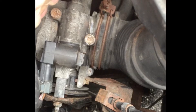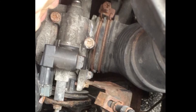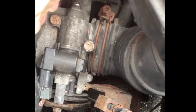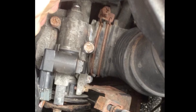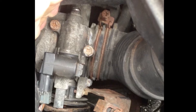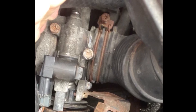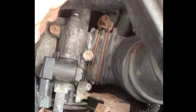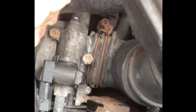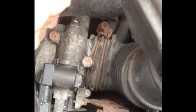Put it back in and see if the problem goes away — most of the time it will. However, if it's still doing the same thing, the shutter valve may still be stuck. Some of these control valves have a shiny screw at the top. If you take that screw out, at the bottom of the screw hole is the end of the shaft that the shutter valve is on, and it has a slot in it. Stick a small flathead screwdriver down the screw hole into that slot and twist it left and right — you'll feel the shaft free up. Continue twisting back and forth while applying more carb cleaner until it moves really nice and easily. It's spring-loaded, so when you take the pressure off the screwdriver it will snap back to the closed position. Once it snaps back easily, it's nice and clean.